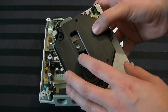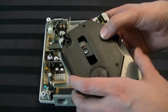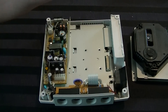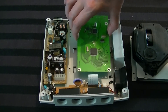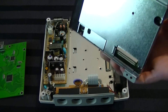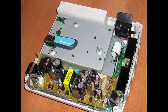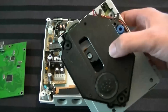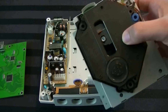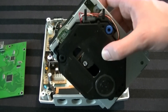Now of course, be very careful — don't touch the lens because that could damage it, assuming this is a working unit. And in this case it is — mine actually works, which kind of presents us with our next problem. So you have your new board and you could just connect it right here and now. Alternatively, what you're supposed to do is take this metal frame, remove it, and install it on that board. I'm not going to do that. The reason I'm not going to do that is this unit functions. Ironically, I don't have any dead GD-ROMs — I only have functional ones. Unfortunately you kind of have to ruin one in order to get the parts.